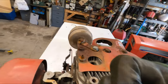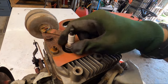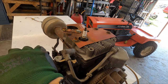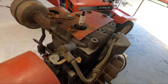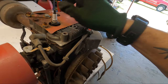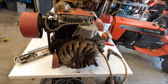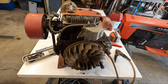My voice is not back — I have to pull it down a couple of octaves just to have half a voice, barely above a whisper. But we're going to put some fuel in it, see if the fuel pump's good, and crank it over to see if we can get it to start. If so, we can stick this back in the Wheel Horse. We had plenty of compression when we checked it some time back, and now we know we've got a good coil on there. This one is throwing spark, so I'm happy enough with that. We'll see if we can get it running.